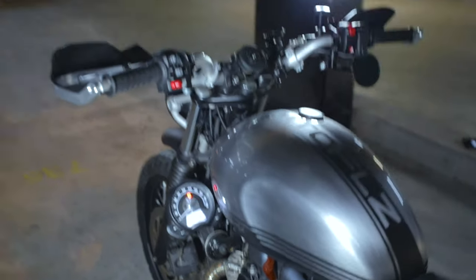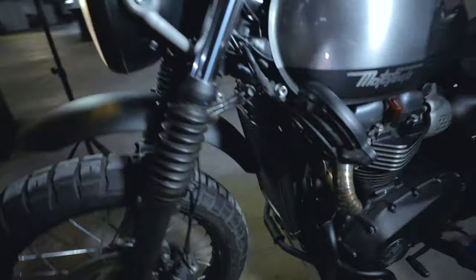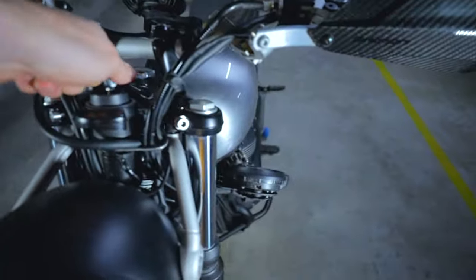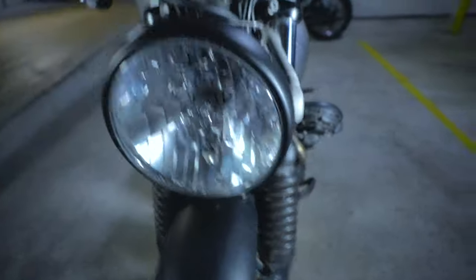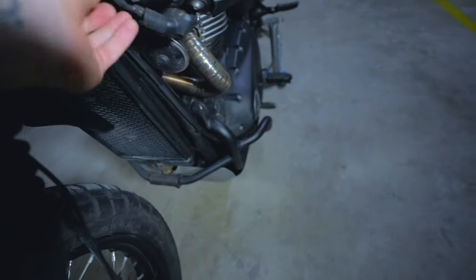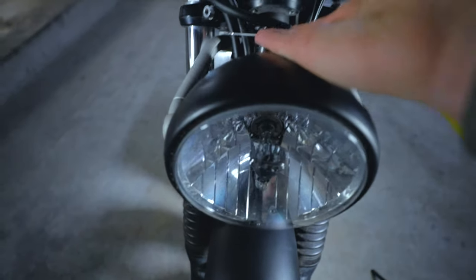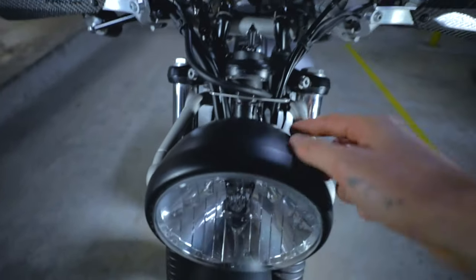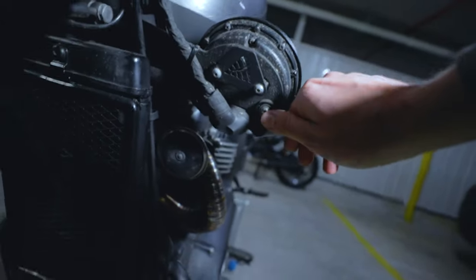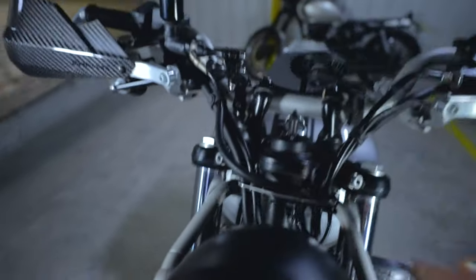And there she is — gauge relocation. I did this a few months ago, maybe like four months ago, and everything seems to be holding up nicely. First, the thing I did was just remove the headlight a little bit. All you need is an Allen hex key set, a Torx bit set or security key set, and side cutters just for cable ties. I just undid those two bolts and brought the headlamp just forward a little bit just to give you enough room to get in there and undo the screws and the big backing cover for the speedo, which is just three hex bolts. That leaves the back exposed — you've got these little Torx security keys, three of those. You can undo those and the whole thing will just drop out, unplug the unit, gauge is free.